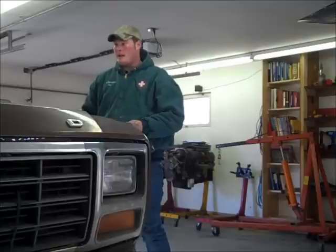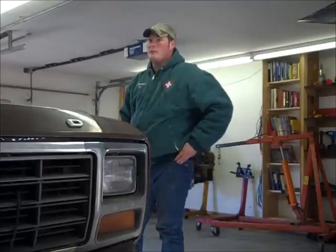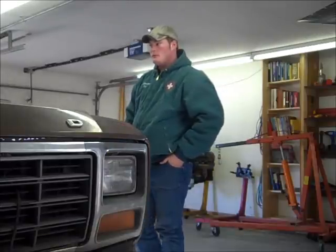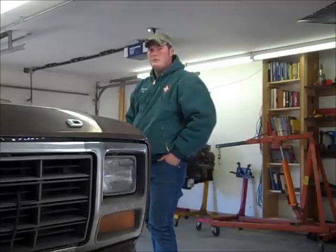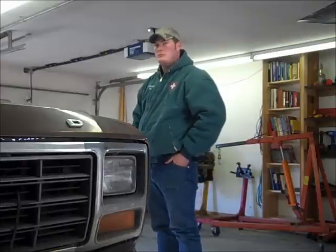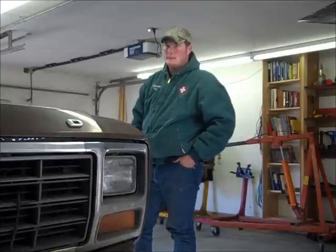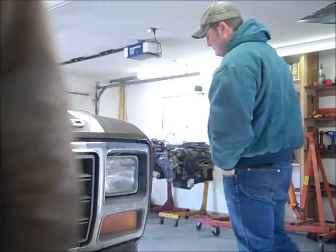It's a lot better than the first time you drove it. It's good. You got that carburetor tuned a lot better than what it was. It's still not the right carburetor though - it flutters a little bit off the start, but once you're moving and your RPMs are up a little bit it could just be an accelerator pump issue. Might need to shorten up that rod or adjust the linkage. I know the timing's still out a little bit because when you get it warmed up it does labor a little to start up.